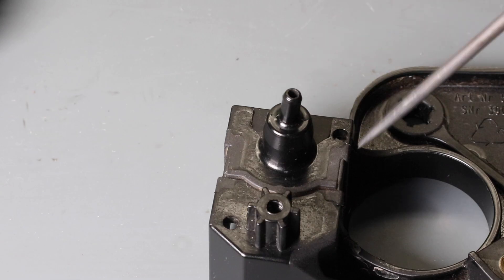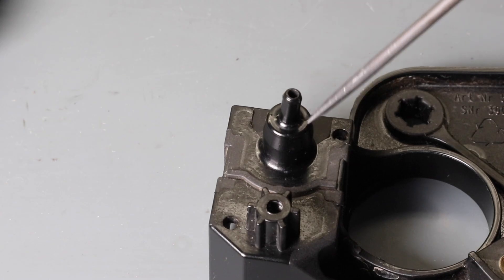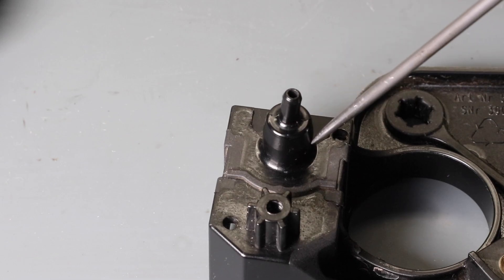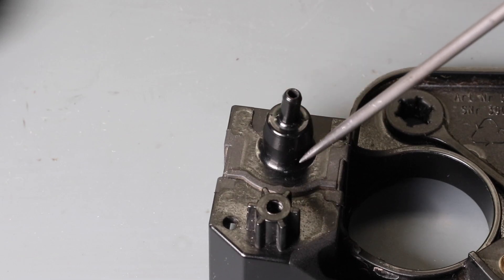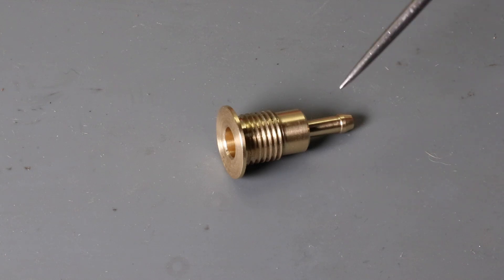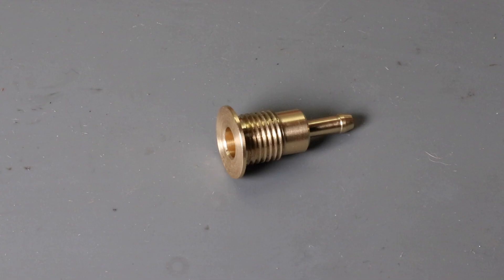Overall, I don't really like the design and quality of the tray in this area. So what I've decided to do is modify it — I'm going to cut this out and create a different fitting out of brass, which the pressure sensor will sit in, and hopefully create a very good reliable seal. Here's the fitting I made, made from a solid piece of brass so there are not going to be any leaks.